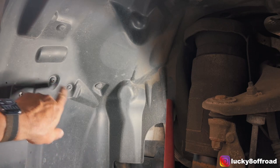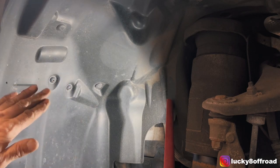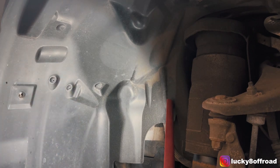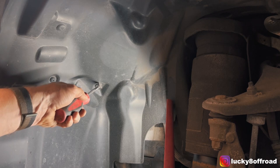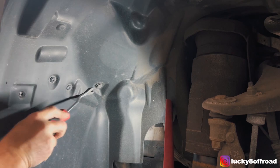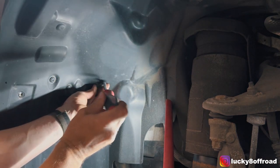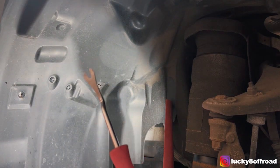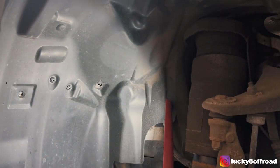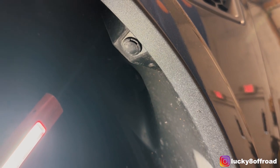Right here are two plastic Phillips head screws — you do not have to take those off, you can leave them in there. That's what's holding your TPMS sensor. The other thing we want to do is get a bunch of these little pop clips out. If you don't have one of these tools, you should — I use it every day. There's one here, one there, and then on the fender flare — another on the fender flare. You're going to want to get those off.